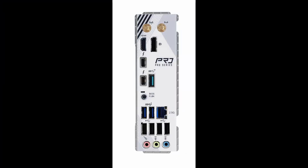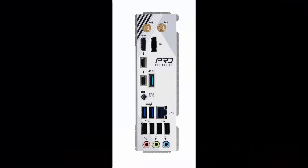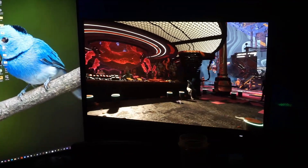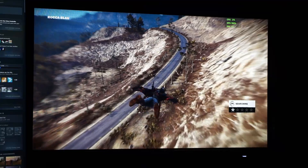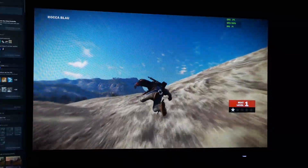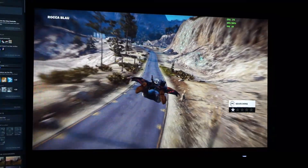The two video ports on this board are very useful for me since I have two high refresh rate 1440p monitors. My vertical monitor is set to 120 Hz and my horizontal monitor is set to 240 Hz. Using this motherboard's HDMI and DisplayPort inputs I am able to drive my monitors at their full resolution and refresh rates of 120 and 240 Hz, giving me a very smooth experience. This is useful since I sometimes go months using integrated graphics, and I have found that the integrated graphics performance of Arrow Lake is very good — better than that of the PlayStation 4. I've been using the integrated graphics to play a lot of games recently, and it is nice that I can drive both of my 1440p monitors to their full capabilities.